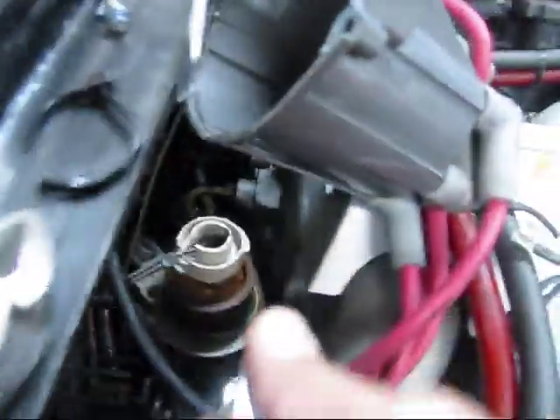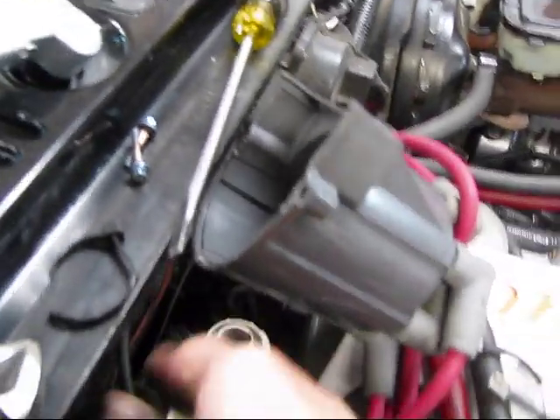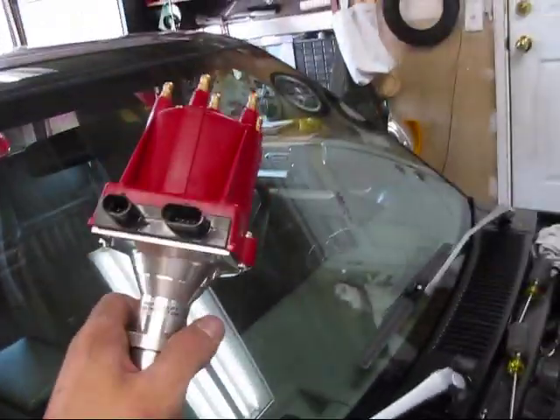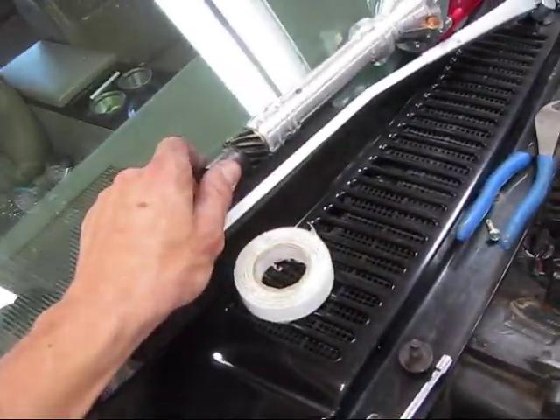You can see where my rotor is currently pointed — towards the back of the engine, just shy of 90 degrees to the back plate of the distributor. When I remove the hold-down clamp, that distributor will pull straight up and out. Because the gear on the bottom of the distributor is angled, when you put it in it will rotate the rotor inside. This is why it's important to check where it was pointed before you pull it out, because it will rotate as you pull it out.